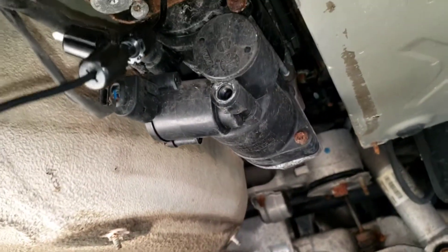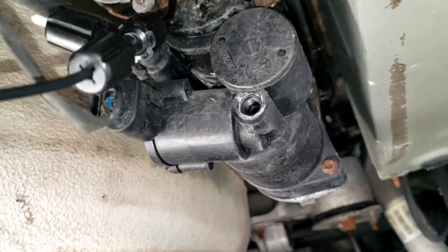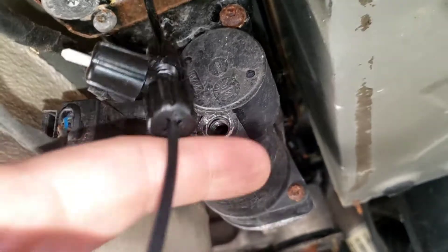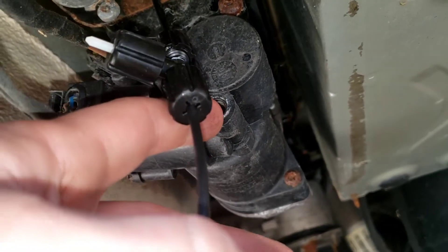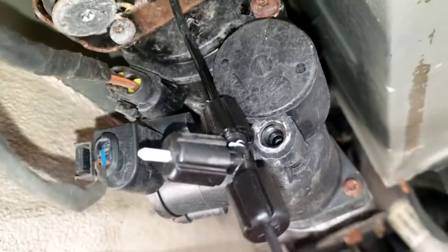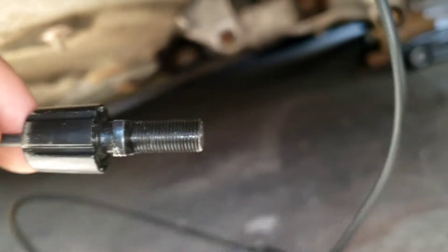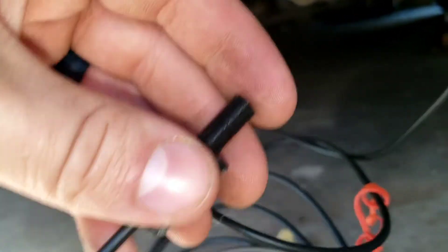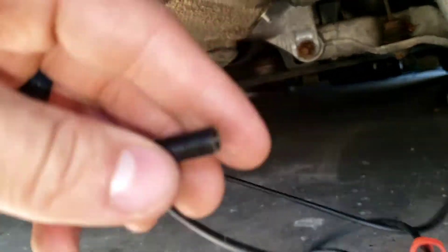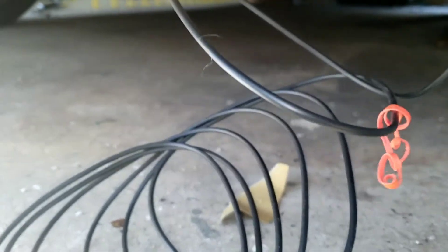Then you would come down here. Right here on the back, underneath from the rear bumper, this is your air pump. There's a hose that comes in right here. When the air pump runs, it pushes pressure out of here, and this hose goes up to that relay block we just looked at. All I did was jump it — I had these little T-connectors and was able to connect the hoses. I had some spare hose, and this is just a standard bicycle valve, an air valve. So now I can open that relay and pump air and be able to fill the airbags manually.